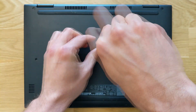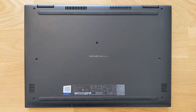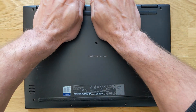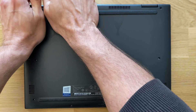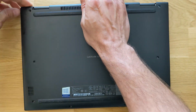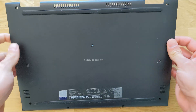Remove all the screws from the back panel — they're all the same size so you don't have to separate them, just keep them all together. Remove the back cover; I'm using just my hands, no tools needed, just a bit of pressure at the back and that cover should come off easy enough. Just remember, take your time, don't break anything — it will come off quite easily.